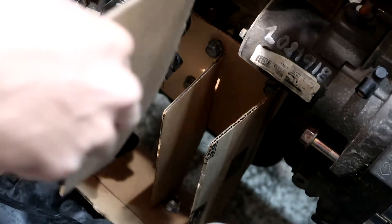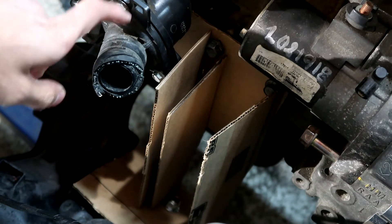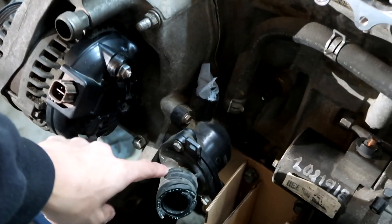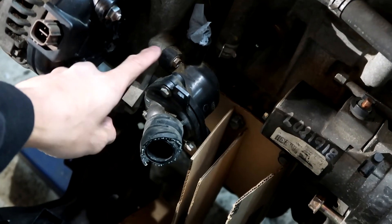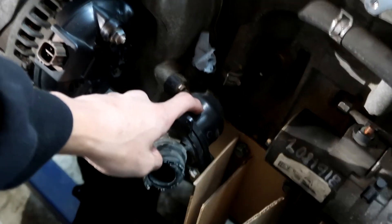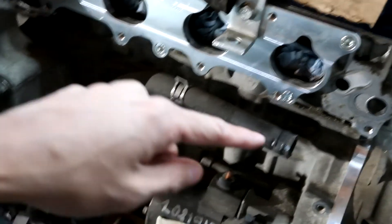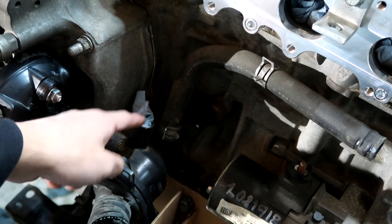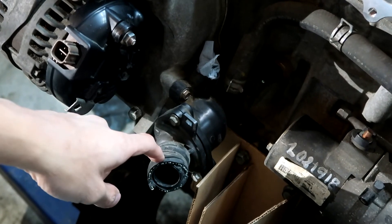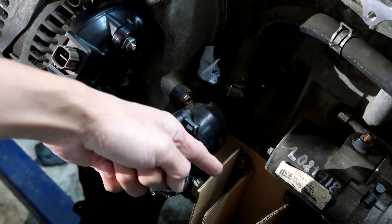Another thing I figured out: the swivel housings that you buy are going to be pointy, and you can swivel them whichever way. You can take that swivel piece and mount it directly onto the water pump housing, which kind of deletes this whole housing here. This splits - one goes to the heater and then this one goes to the intake manifold. This one I will be plugging. I've been trying to figure out which ones to get and whether it's going to be necessary to keep this here, because if I just put it here it will make more room.